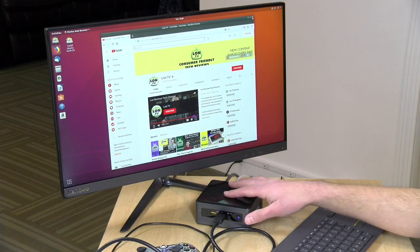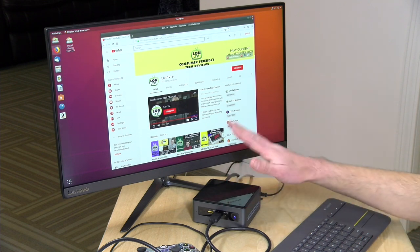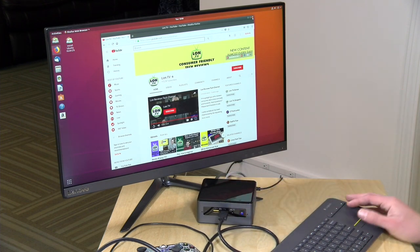When we did install Windows, we had to go to Intel and grab their drivers — about 10 or 11 different drivers downloaded and installed individually. Intel does have a tool that installs on the NUC and auto-updates, which might be the easier approach, but initial setup was a task. Over time those drivers get integrated into Windows so first boot won't require that process. Oddly, Intel's graphics driver page was linking to Kaby Lake drivers, which were incompatible — I had to use their prior edition drivers to even run our tests.